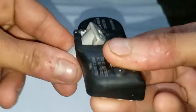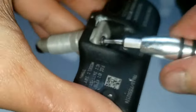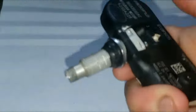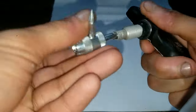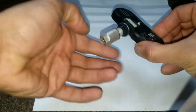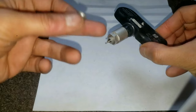Quickly reinstalling: put the valve stem back in and fold the flap if present, then secure the screw with a T6 bit or similar. Next, put the washer back in, followed by the rubber grommet — just keep turning it in. If the valve core was removed, screw it in by hand first, then use the multi-core valve tool to tighten it. This nut will be put on after the TPMS is put back in the wheel rim, and then you'll put air in the tire and put the dust cap back on.